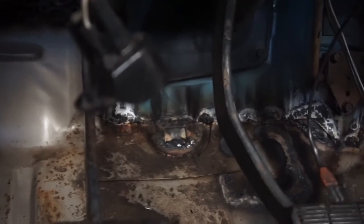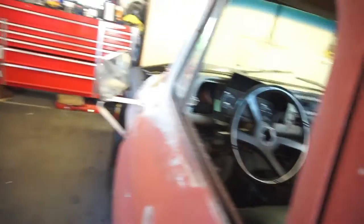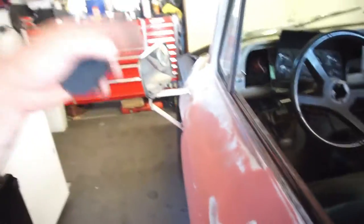We got all this cooked, burnt paint from welding. I gotta adjust the four-wheel drive link because I did move it back — it won't go into four high. It goes into two-wheel drive, neutral, and four low. The lever under there can be adjusted.